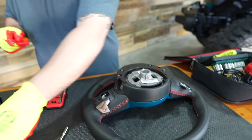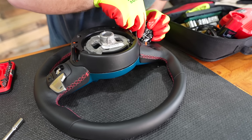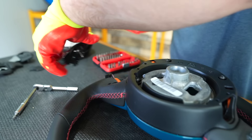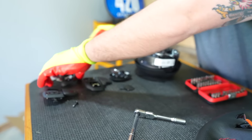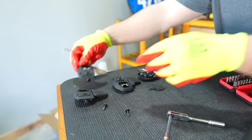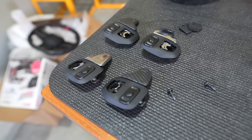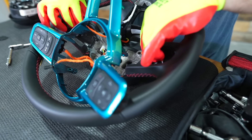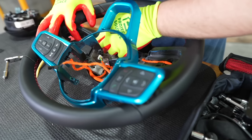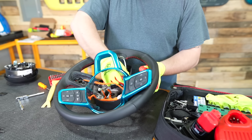We're going to take the caps off. We will reuse those in our brand new carbon fiber paddle shifters. It should pull out just ever so slightly and we can use our little pick to depress that right there to remove this one. The screws are still in both of them — let's pop those out and set them right here next to the paddle shifters. We've got most of that wiring popped out; these just run right along that little channel there. And actually the back half of this steering wheel comes off as well — it's kind of major surgery.